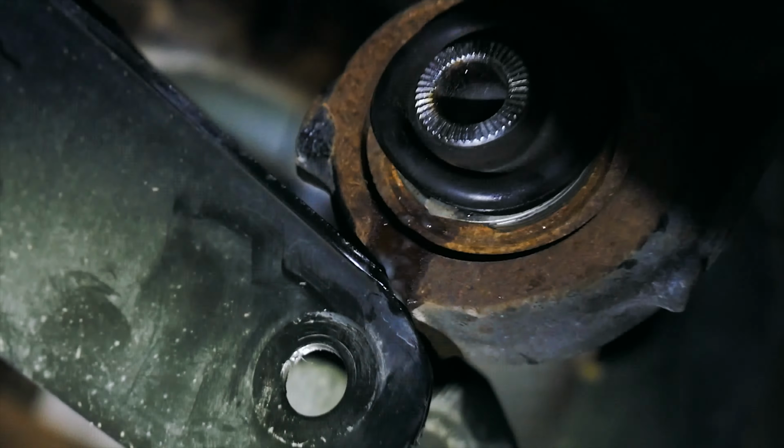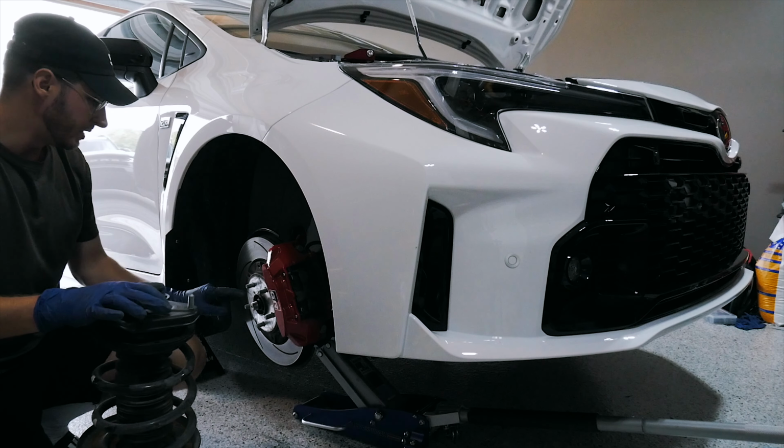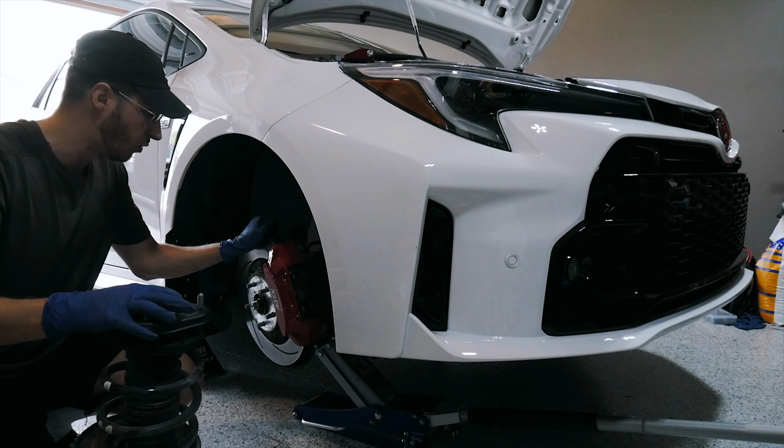All right, that's gonna bring me to point number 3, and that is gonna be in the front where I pulled the knuckle down on the top, and I'm gonna show you here in a video exactly what happened. Where I screwed up before was this axle on the CV inner joint. You do not wanna let this hub spin at all when this is off, because if this pulls down and drops and swings forward, like right now, I can angle this up inward from the top. But if this gets pulled down too much from the top and you spin this by accident, you could pull that joint out, and then whenever you put this up and go to push it back, this actually won't even move at all.